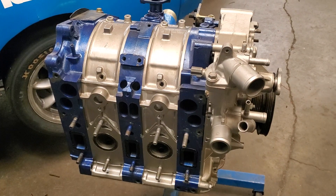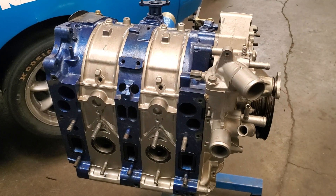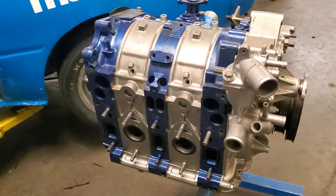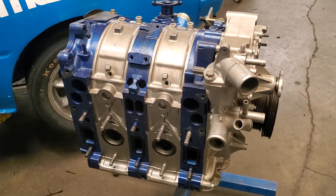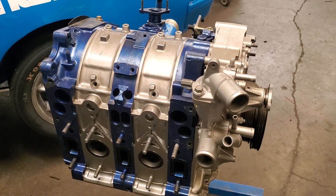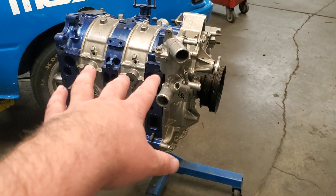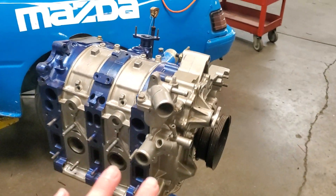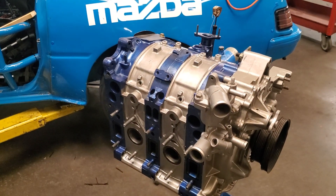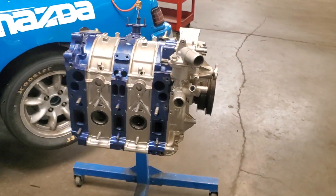When we did this, it was still a complicated build — RX-8s were new and there wasn't a lot of modification work done yet. As that chassis has become more viable, there's a lot more interest in these builds, and I think it's as viable as doing any other swap into the RX-8. This is not a direct off-the-shelf build: your exhaust manifolds don't exist, your intake doesn't exist, your fuel system needs to be redone, and piggybacking computers on RX-8s is difficult because they're a CAN system. Obviously in the U.S. we have federal smog laws, so this was for a race car in off-road use.